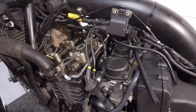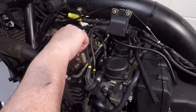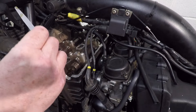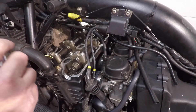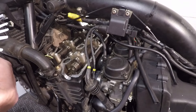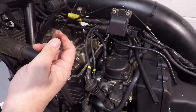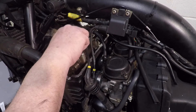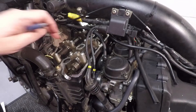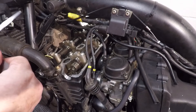I'm just going to show one of my exhaust valves. On number two cylinder here, the exhaust valve is off cam. A 0.15mm goes in there, so I know my gap is not smaller than 0.15. My maximum is 0.20mm on the exhaust, so I don't want 0.20 to go through — and it doesn't. That bodes well for number two exhaust. I'll find out exactly what it is for reference — 0.18 doesn't go in, so it must be 0.16 or 0.17.